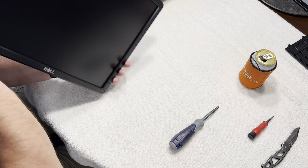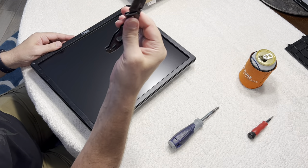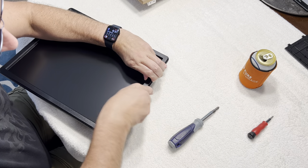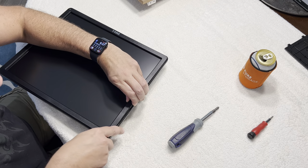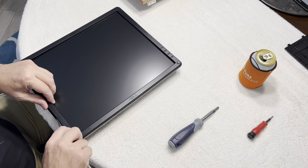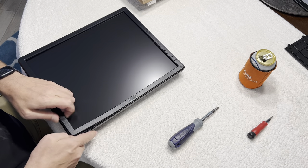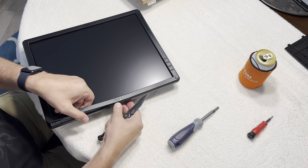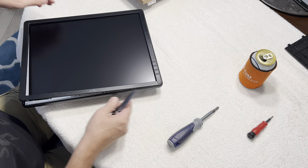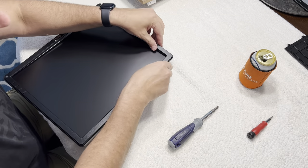That's all you have to do — take those six screws off and then just pop this off. It's just got little plastic tabs around the edge. I use a knife; I don't recommend using a knife, you probably want to use plastic. Just be careful, take your time, work your way around the edge. The tabs — all you have to do is just get them out a little bit.